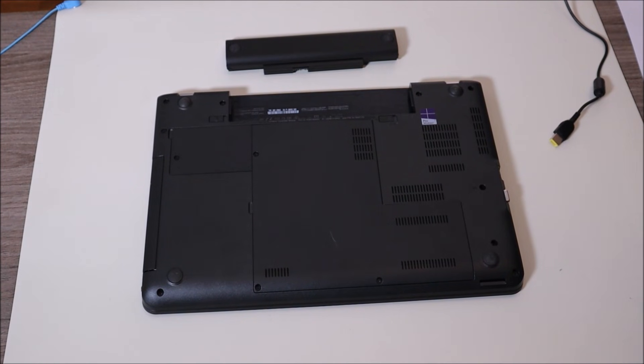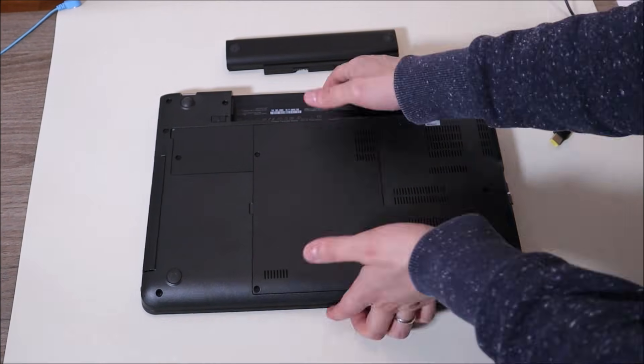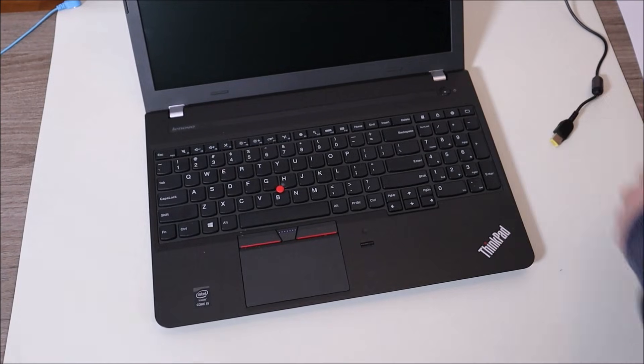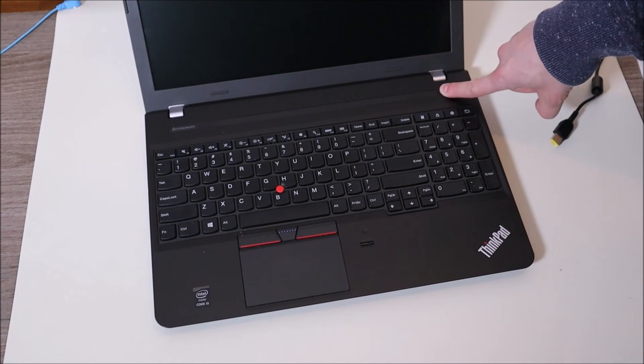For a lot of you, it may still work without removing the battery. If you do want to do this test the right way and your battery is internal and not easy to access, there'll be a video link in the description below on how to access an internal battery. After you've removed the battery and unplugged your charger, flip your computer back over and press and hold that power button again for one minute. A lot of times, power will build up in various components that shouldn't have it, and that can interfere with your computer even turning on. By doing this, we're draining the power from those components.